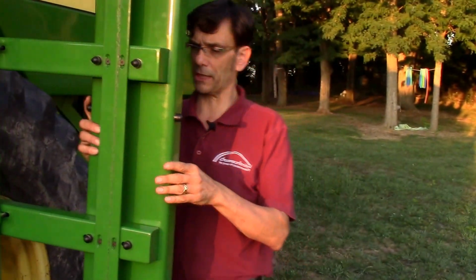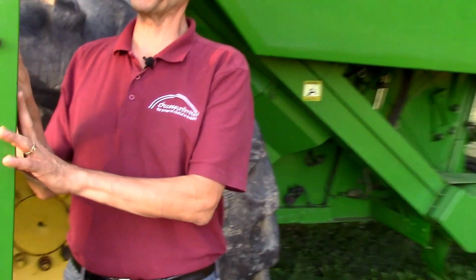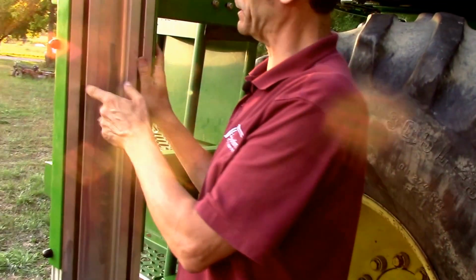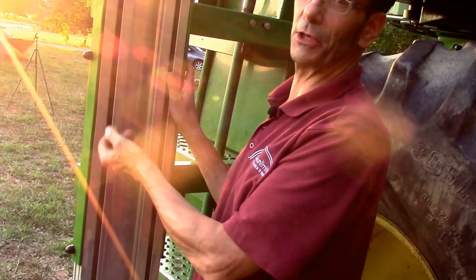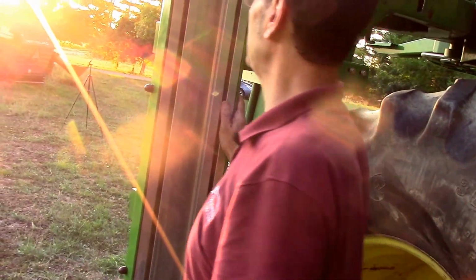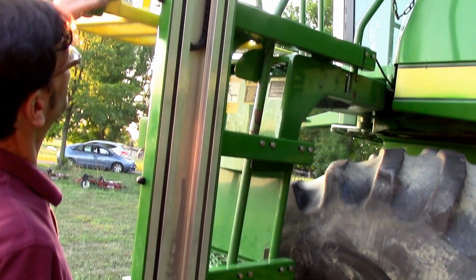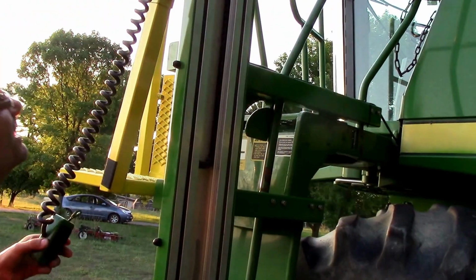Okay, coming around the other side here, you do not want to lube the track. Because this is not intended to be lubricated, especially if you're in a dirty environment. All this is going to do is pick up dirt. The bearings are lube impregnated. I'll bring that down so you can have a better look at the trolley.